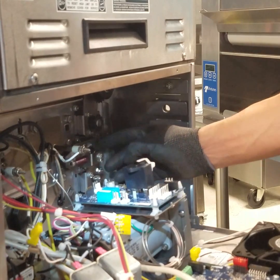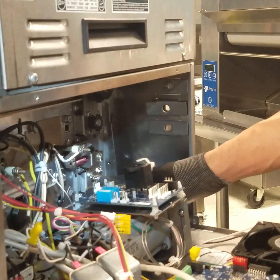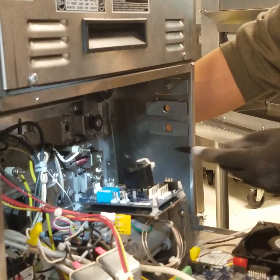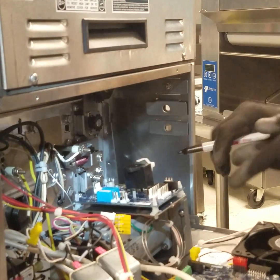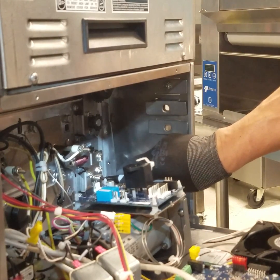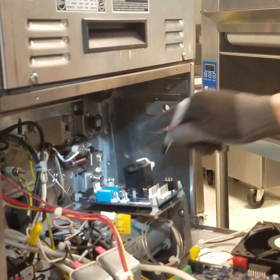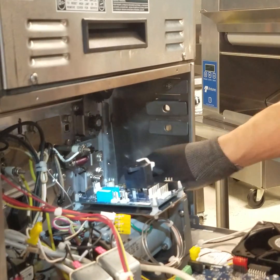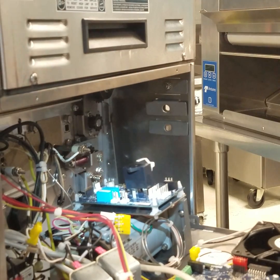With the spring tensioner bracket installed and secured with the 3 hex nuts, rotate the bottom drive shaft by reaching around the front of the machine and rotate it until you notice the pre-drilled hole in the shaft. Take a black Sharpie and make a slight mark at the end of the shaft to coincide with the location of the set screw dimple. This would allow reinstallation of the drive sprocket and location of the set screw in the dimple.